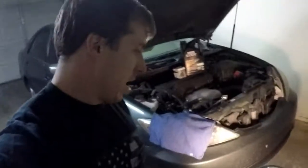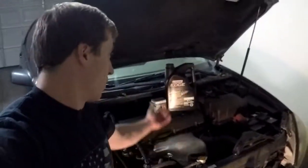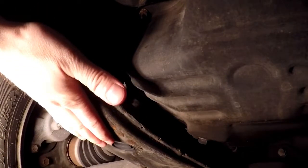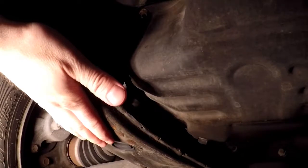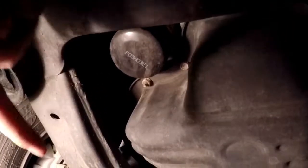Because they treat their metal babies right, we've got Castrol and a good Bosch filter. The oil drain plug is right here - it looks to be about a 14 millimeter - and this is the passenger side of the car. The oil filter is in one of the most accessible places possible, right here.